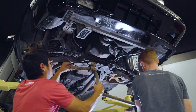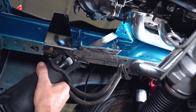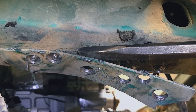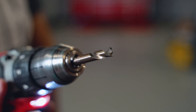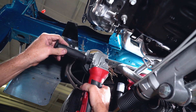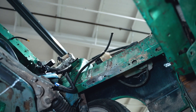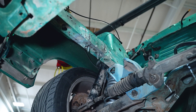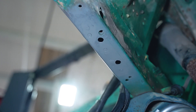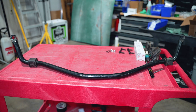You also want to remove the factory Fox sway bar and the end links — the entire bracket needs to be removed from the frame rail. Go ahead and remove the factory Fox sway bar brackets by drilling out the spot welds with an appropriate spot weld drill bit, and ensure that the underside of the frame rail is completely flat. You may have to grind this smooth with a grinder. For the sake of our situation, this is our R&D car so our sway bar brackets were already removed prior to the install. Use a rust preventative paint and cover any uncoated metal surfaces, and do the same for the other bracket.